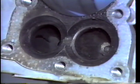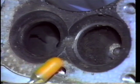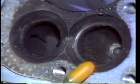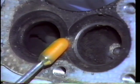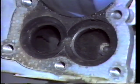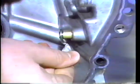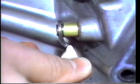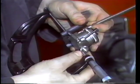If the valve seats are in the block, inspect them closely for burning, physical damage, or wear. Also, check for cracks between the seats. Inspect the other areas of the block for troubles. For instance, you should check for wear at the governor lever now to avoid fixing it after you have finished your rebuild. Next, measure cylinder bore wear.